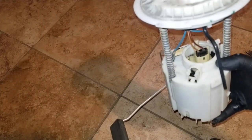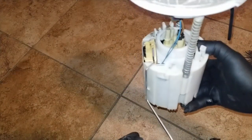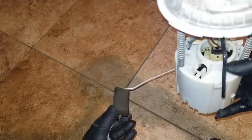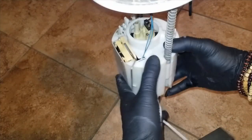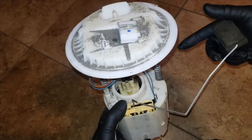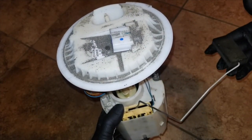Here's your fuel pump. In the Mercedes, there's a fuel pump on one half because the tank is separated into two halves, and there is a float on the other side as well. When you fill your car with gas, this float right here registers the height of the fluid — the gasoline — and that gets converted into voltage based on the resistance as it goes up when you have a full tank.